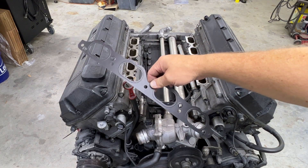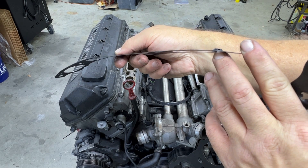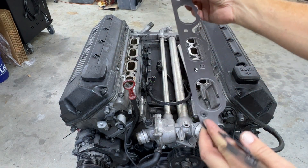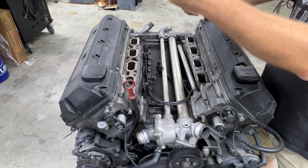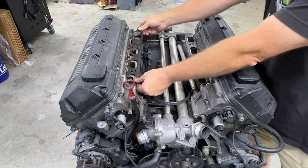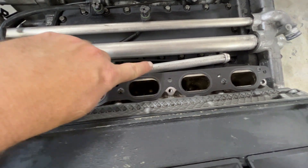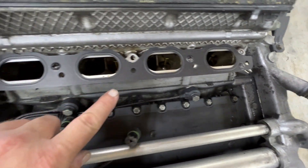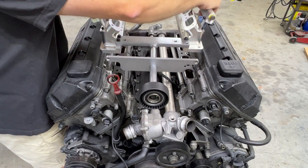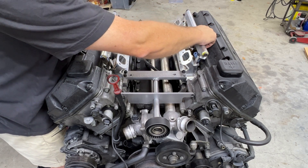The included metal gaskets are from an N62 engine, so they will be using two alignment holes. Make sure that the embossing is pointed up. Note the alignment of the threaded holes — these are all the alignment that is needed for these gaskets. Carefully place your adapter back on top of the engine and maintain the gaskets in position.